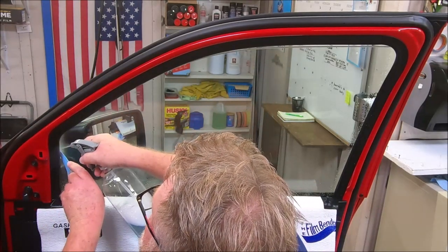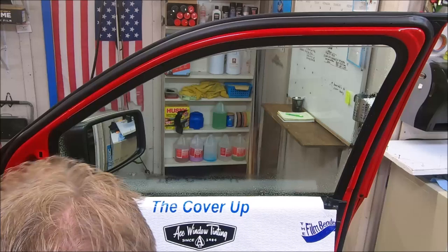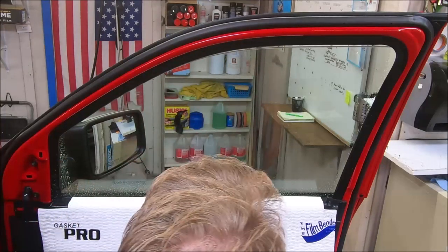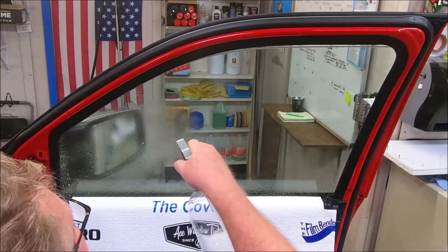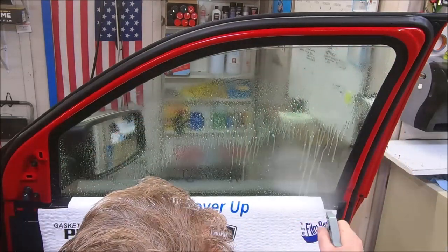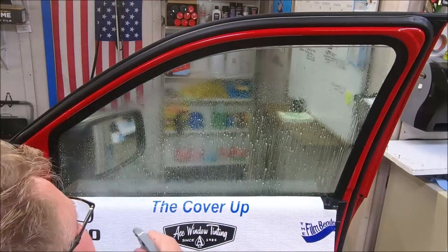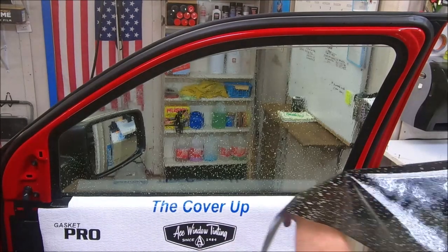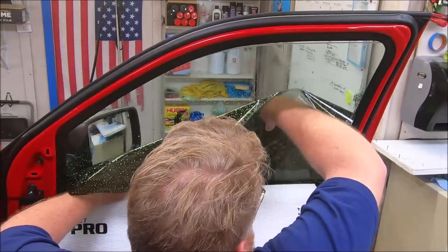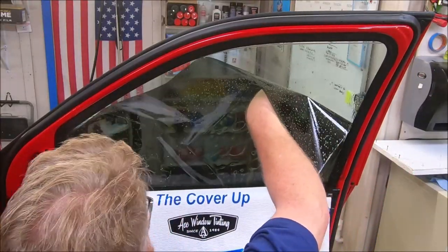Something else you'll see in this video: I don't shrink these windows. I use a great squeegee, a great film with a great adhesive, and I do what I call the 'cheating the fingers' technique — something I'm going to show you now. When you know your mix solution is right, you spray the glass. This is a bottom load and I do have the seal pulled out — it takes just less than a minute to pull that seal out. I always drop the short side in first, not the longest.